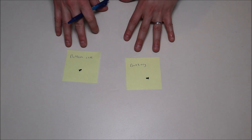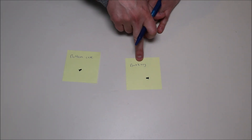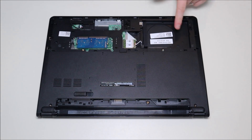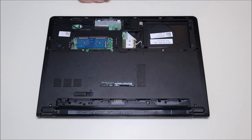A quick suggestion for screw management: make sure you keep them separate from each other. Screws are not all the same size, width, or length in different parts of the computer, so make sure you know where your screws go so that when you're reassembling your computer you can put them back in the correct spot. One tip — when I started computer repair I'd write sticky notes like 'battery screws' or 'bottom case screws' to keep them separate. So here you have a hard drive space right here where you can put in an additional hard drive, your Wi-Fi card, and your RAM card.